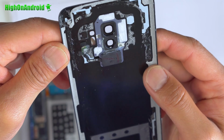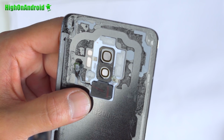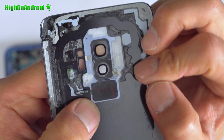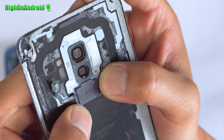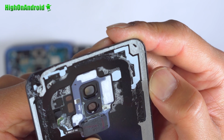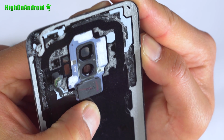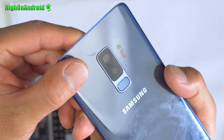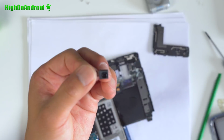This is bad. Alright, taking a closer look at the back glass cover, you can clearly see where the salt water seeped through on the bottom camera lens housing. I imagine it was the USB port that had corroded too. Now, what most likely happened was that in my first day outing, I did not rinse off the phone and some of the salt water droplets got into the camera housing, and I suspect there was some metal there. And in my second day out, the corrosion that happened during the first dry off on day 1 made the camera housing weak and the salt water just came through. And I admit I actually took this phone like 10 feet underwater while diving and I think that didn't help either. Taking it further apart to see any more damage, the camera was just fine.